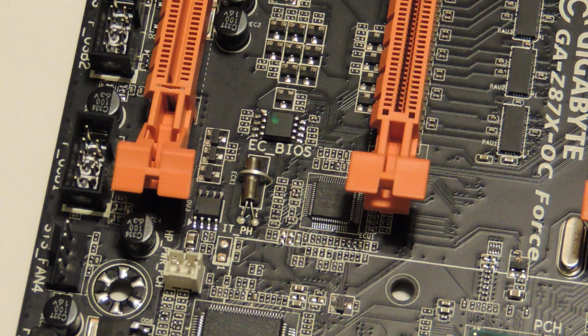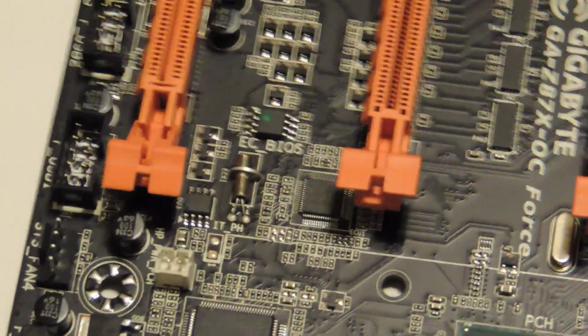However, it also provides something else. It takes some of the functions off the BIOS, and it also allows you to store profiles after clearing the CMOS. So your tag profile will still be there after you clear the CMOS, as will all your saved profiles. It also allows 2 different CMOS settings for the different BIOSes, which wasn't there before.